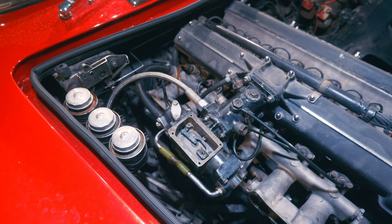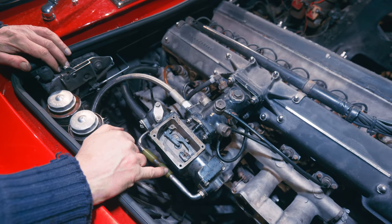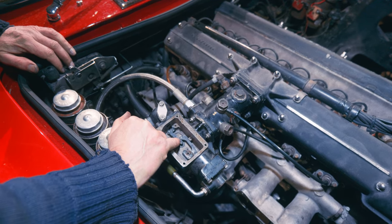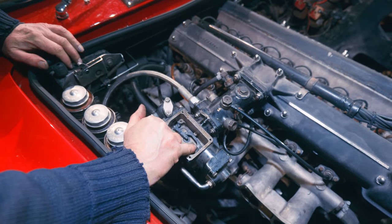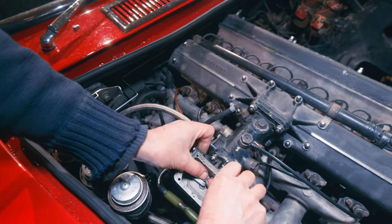So adjusted the choke back. So you can see the manifold depression is pulling that in that direction, which is pushing that in. We've taken the choke off a bit, so we've altered that angle from being down here to there. And there's our rollers. And it's forcing that in, isn't it? Now, if I push that in manually, it'll weaken this off a bit.